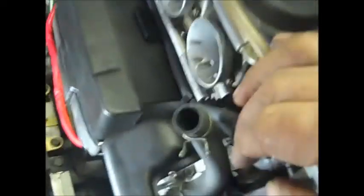Make sure this other hose that also goes to the airbox is still out. Check that no wires came unplugged — check everything because the airbox isn't really easy to take on and off. When putting the airbox back on, these clamps have a little notch in the rubber boot that goes onto the carburetor, and the clamps have a spot built right into them to fit into that notch.